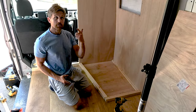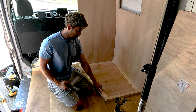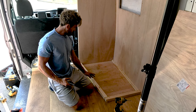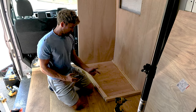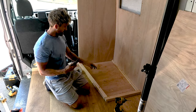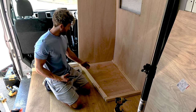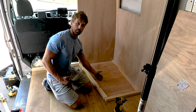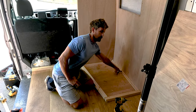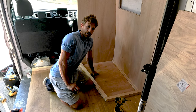While the ceiling is drying, I'm going to carry on with the shower tray area. What I'm doing here is creating the outside wall of the shower area. We're going to have a small nib coming from about here all the way up to the ceiling, and this part is going to be open, but I am still putting a sole plate for the wall because I'm going to use this as somewhere to put the waterproof and tanking to. I've already put a batten and I'm going to be putting another three battens in, and that's going to form the outside edge of the shower tray.